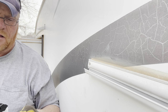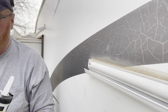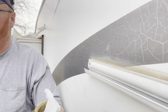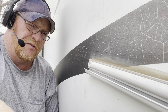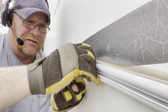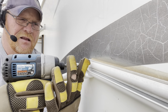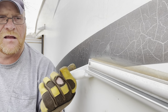Silicone both sides. While you're doing this, while you're up here, it's a good time to check out your seals and everything — your rubber seals. Make sure they're still in good condition, good working order. That's what keeps water from getting inside of your camper and stuff. So I recommend keeping a good eye on them. Pull it out just a little bit, flap it up in there, just like so. Screw — it may have been wrong, it may actually just be the self-tapping end of it. We'll see. There we go, she's in there.